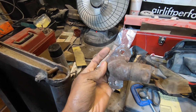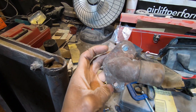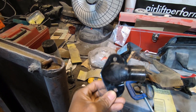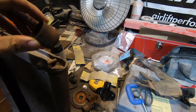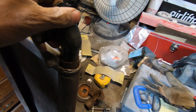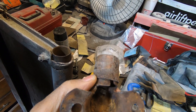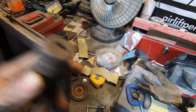This is the original hinge and you can see it's kind of buckled in there, which was preventing it from sitting straight - you can see it's a little bit cockeyed. So I went to buy new hinges from Bill's Truck Shop. When I asked Bill for the hinges, I also needed this piece which I thought was a bushing. It is not - it's actually supposed to stay in the bed and the hinge rotates inside of it, giving it the rotation. This one was all bent out of shape and wouldn't rotate, so the tailgate was not opening well at all.